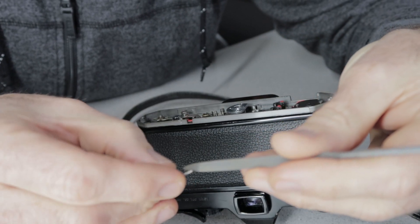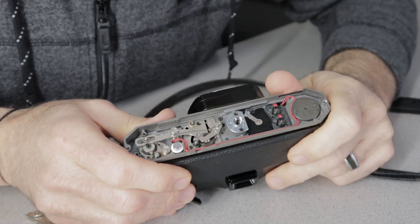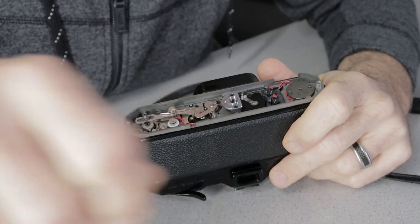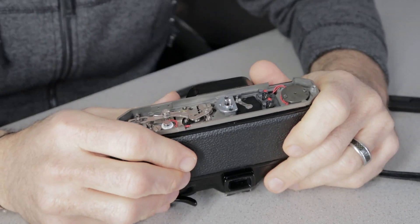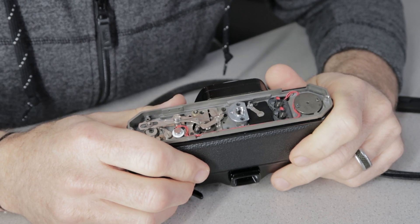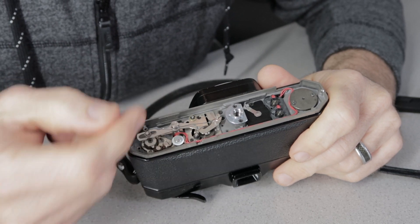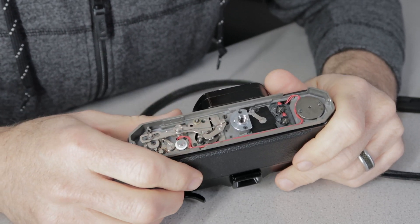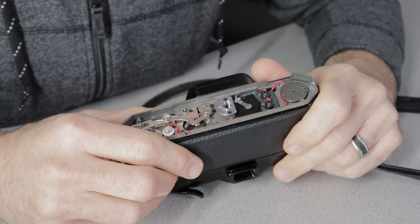Grind until the black mark is gone on the very corner — you don't have to grind the entire edge, just the corner. We've ground a bit off using this little jeweler's file; sandpaper would work too. I took the arm out rather than grinding it in place because I don't want to get metal dust inside the camera. Taking the arm off lets me hold it and control it better while keeping the dust out.